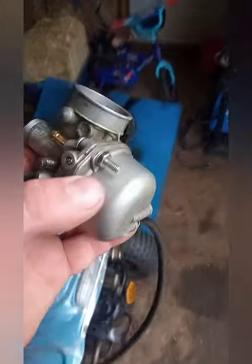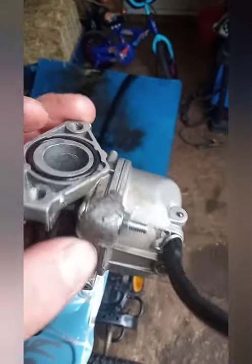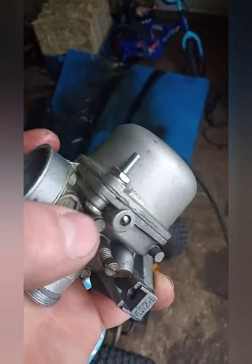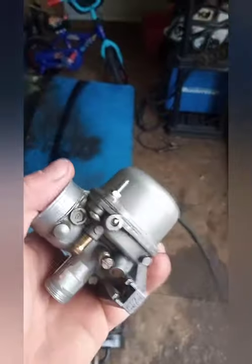Got the breather slacking up, getting that out of there. I've got to pull the carb out. Like I said, this was one of those carbs they didn't want you to take apart — so they drilled the screws and put bolts through there. It looks fine on one side, but on the other side it obviously leaked, so I've got to get that off. Basically take off these two — this one looks a little different, has thread in it. I'll get the cap off and come back and show you once I get it off.